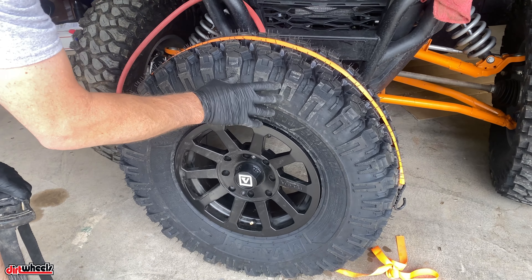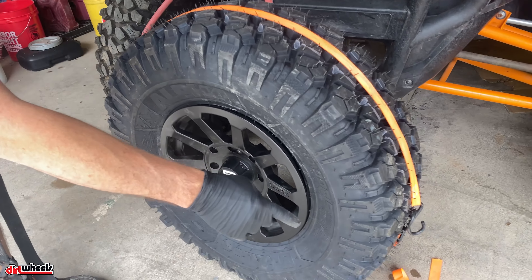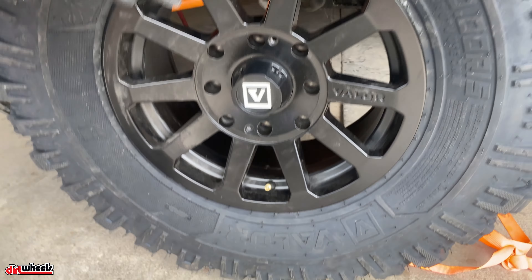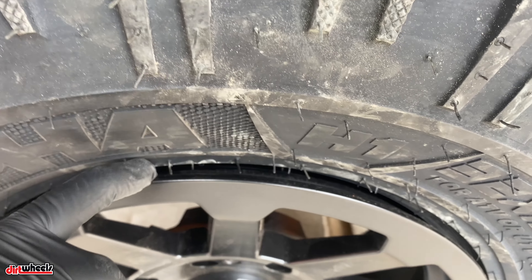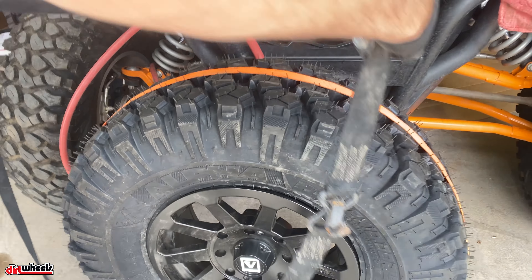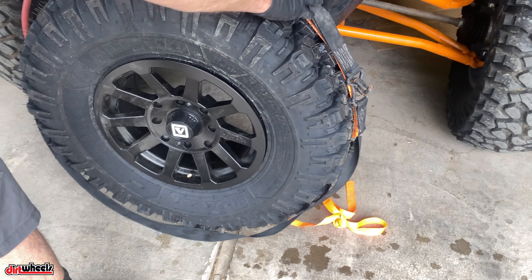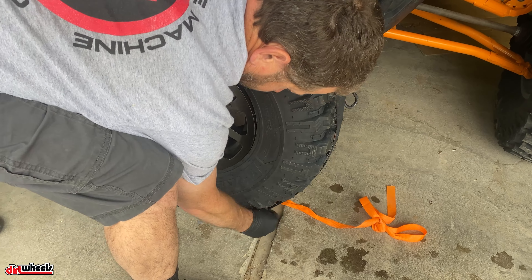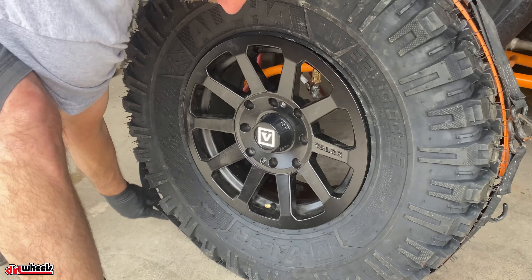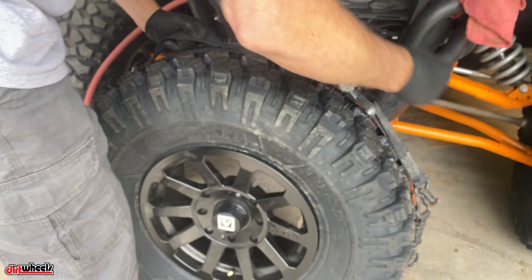We're in the shop closer to the air. To seat the tire on the wheel takes a little effort — you'll notice we have a ratchet strap around the circumference of the tire with the handle near the valve stem. The ratchet strap pushes the sides of the tire towards the bead of the wheel, which helps when we put air to it. We're going to do a second ratchet strap with the handle on the opposite side, as close to center as possible. Have them both snugged up.